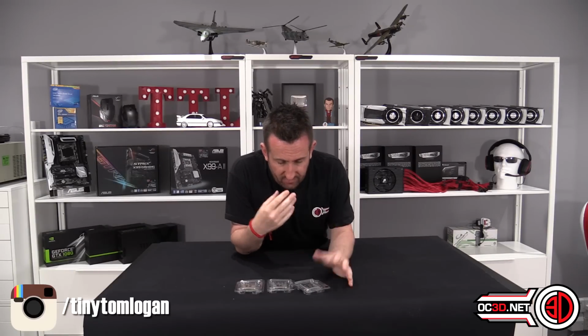Essentially, what it is, you get the turbo boost. So with the 10 core, it's 3 gigahertz, and then it boosts up to 3.5. But what the Turbo Boost Max does is it gives you a single core, which will then ramp up to 4 gigahertz. So if you're working on something that was single threaded, one of those cores would go shazam, and it would go up to 4 gigahertz, which sounds wicked, and it really is, but it's only one core.